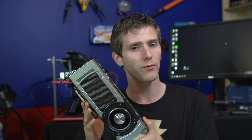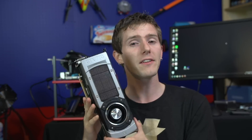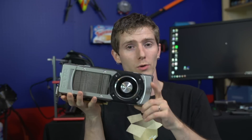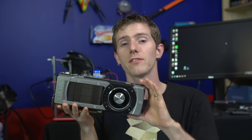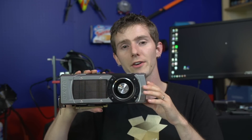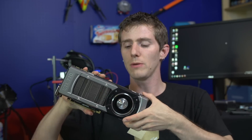What they've done is taken a full-fledged GK104 GPU, just like you find on the GTX 680, paired that with 7 gigabit per second — so 7 gigahertz GDDR5 memory — faster memory, and then added some new technology: GPU Boost 2.0, an updated cooler, as well as a new fan profile that makes the card quieter while running cool due to GPU Boost 2.